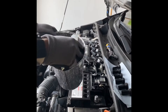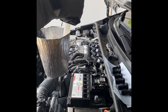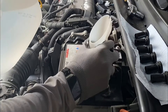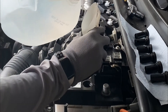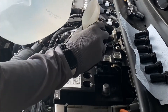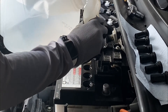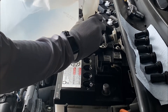What you can see here is me using a bucket to rinse off the funnel that I'm going to use to fill each one of my electrolyte access holes. Be sure that the water you're using is distilled water. Using the funnel, add just a little bit of the distilled water to each one of your electrolyte access holes. Regular water or tap water contain minerals that will ruin your battery.